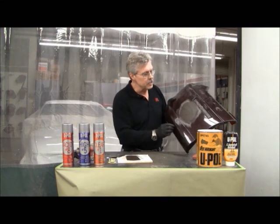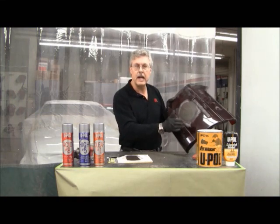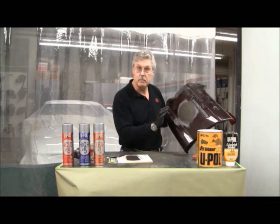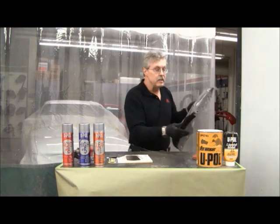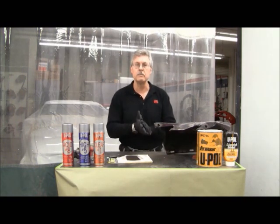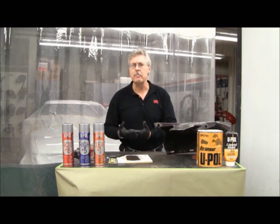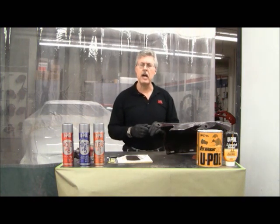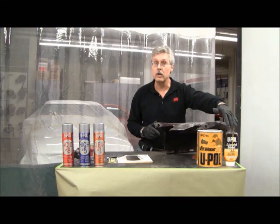Generally, on an application like this — where we had some very deep gouging and actually had a hole through — it's going to take two coats of material. The first coat's going to fill it, we'll have a little bit of a low spot, we'll come back and sand it, block it down, find where that low spot is, isolate it, put another coat over it, let it set up, and then come back and DA it down once again. The product sands very, very easily — that's consistently what people like about this material — how well it sands and just turns to powder. It doesn't really load the paper up the way a lot of your two-component products will with a plastic repair item. Generally, our sand time on this material is about 8 to 12 minutes, basically what you would have if you were sanding body filler or a glazing putty.